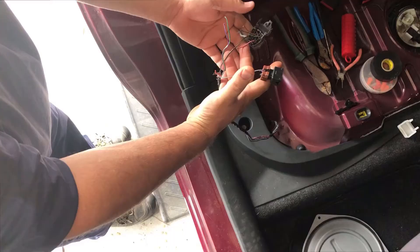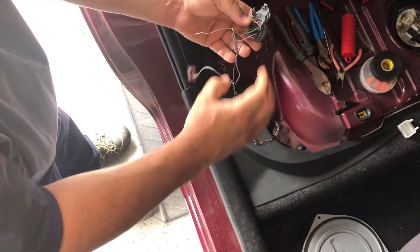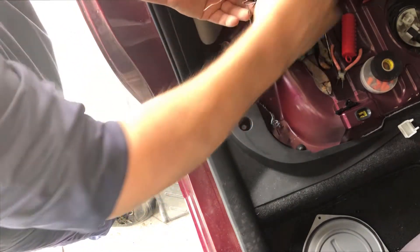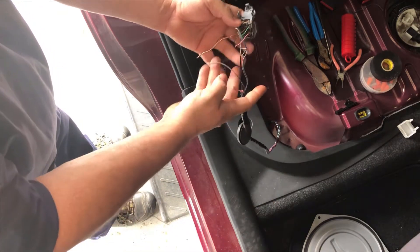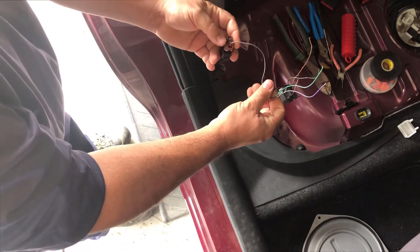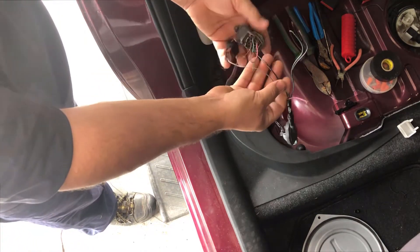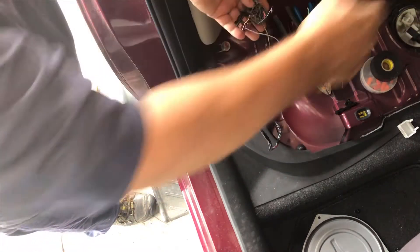My goal is to do away with the pressure sensor first, see if it'll run without the sensor, and make a temporary connection to confirm it's going to run. That'll check the gauge and the components of the canister - I believe the fuel pump is in there as well. Then I'm going to clean it all up, take it down, solder some ends back on since it's a little tight to splice here. I'll extend those wires, pull it all out, fan it out, and get it prepped to rewire it cleanly in compliance with the fuel components in the back of the car.